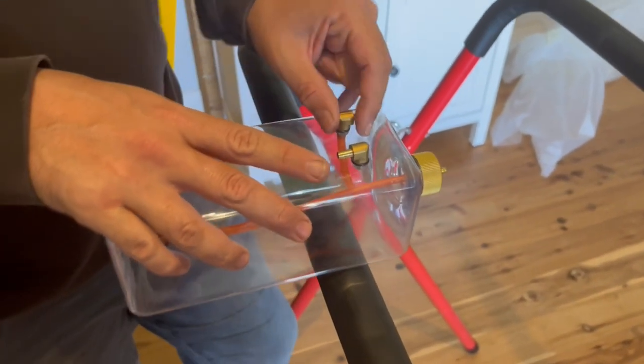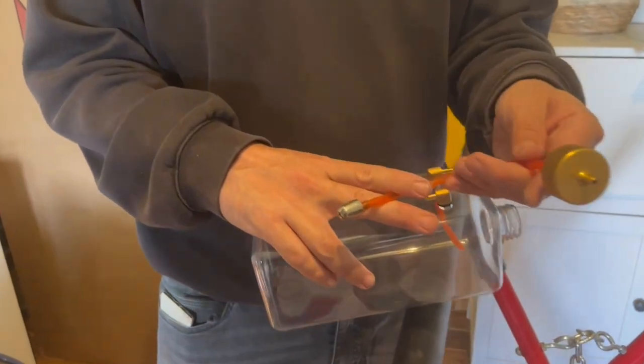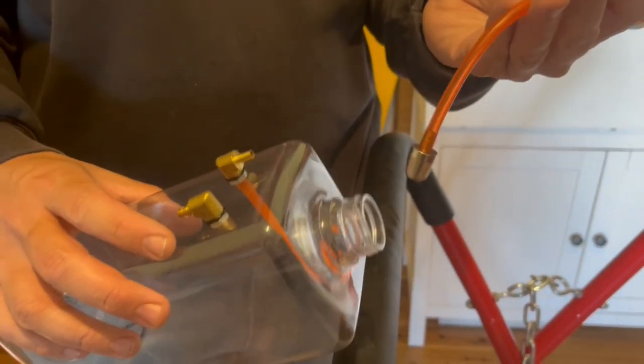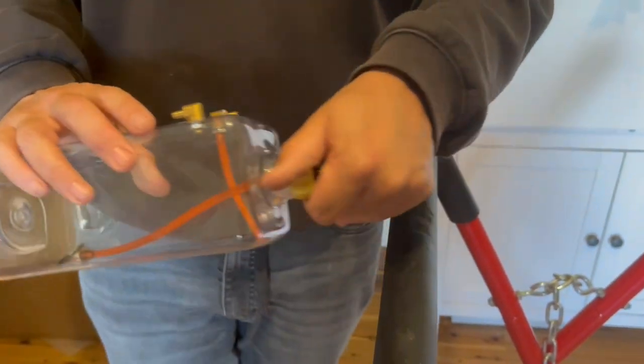I found that that'll gradually loosen up the little nut behind here. So what I do is I run a filter on the inlet line and I cable tie that into position in the airframe. We'll cover that when we get to the fuel setup on the plane, but that's something that I find stops these eventually wiggling loose. Another change we're going to have to make with this fuel tank is that this fuel hose looks like quite good quality, but we still have the problem that it could bend over in flight and find itself up the front of the tank. So we'll probably run some kind of a tube over that just to stiffen it up.